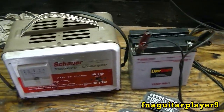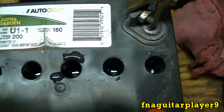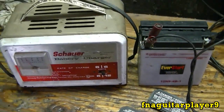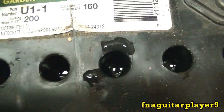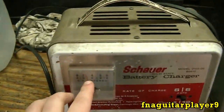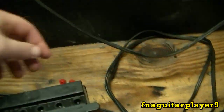Of course putting the acid in when you first get them — with this type of battery you don't have to do that, which makes it easier and safer. Most newer lawnmowers will use this type of battery. It's been about an hour and it's staying right at three, so I'm going to go ahead and take it off charge and stick the caps back in. The other one's down to zero now — this should be good.